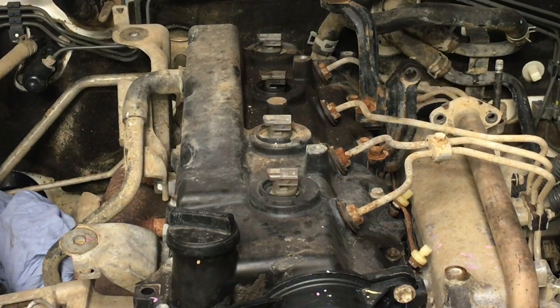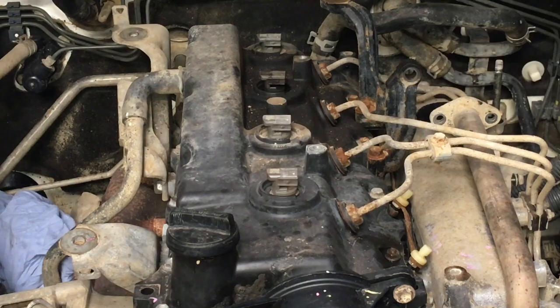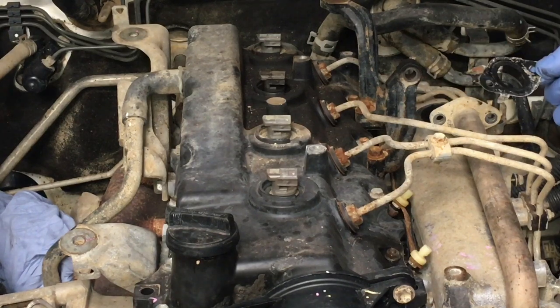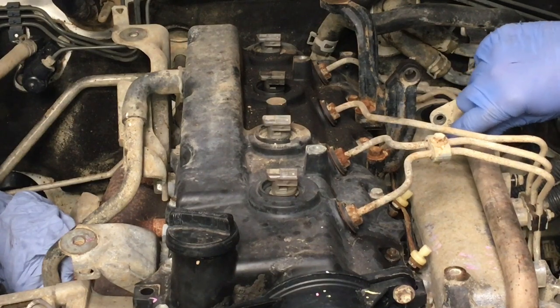So, with our injector kit, we'll supply these gaskets, right? This one, obviously, because that's a mess. This one needs to be replaced, the one above it. So, this is a good little re-summary of the gaskets required. With a Euro 3, you'll get one of those, two of those and the square one. That one usually can be reused, people put a plate in there. Like I said, that's solid still.